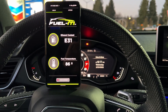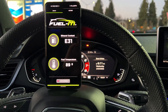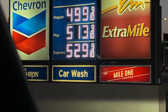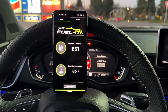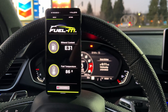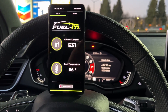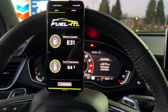This could also be done by driving around while monitoring the sensor — you can see when the ethanol content starts to rise at the rail and make changes accordingly. At this station, 91 octane is $5.29 a gallon whereas E85 was $3.39 a gallon, so definitely happy to be heading back to the good fuel. I'll rev it now and again to get things moving, because I know the exact content. 91 octane can be run on E30 without much issue — it effectively just fills out any timing correction.